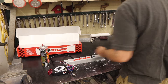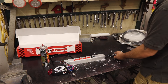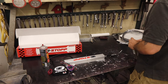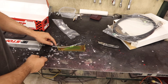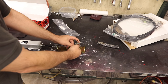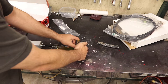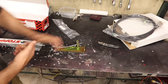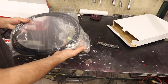That's actually a part of the system. So if you have a functioning e-brake system, this would just go in place of where the one from your pedal or your handle goes. In order for this to work, you do need a bracket — long and the short of it. This bracket goes through, you'd take this nut off, obviously tighten it down over there. This goes through here and your existing cables will go through and pull that way — it'll pull this way on your two existing cables. I don't have existing cables, as I mentioned. So I bought this universal cable kit and I'm going to get it installed on the truck today.